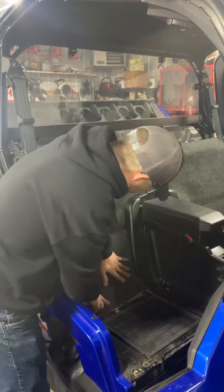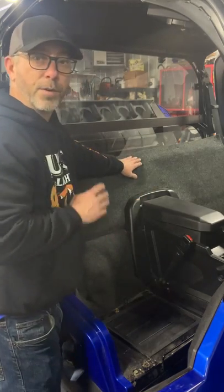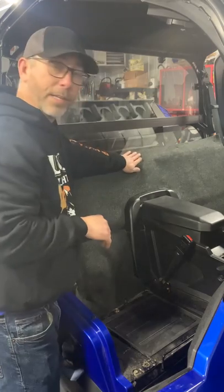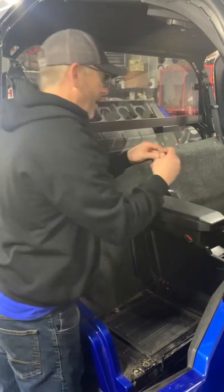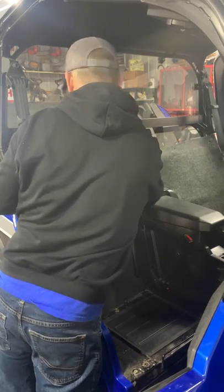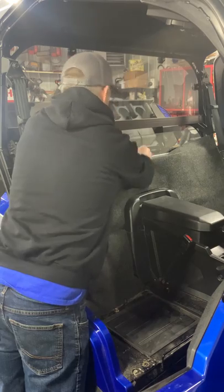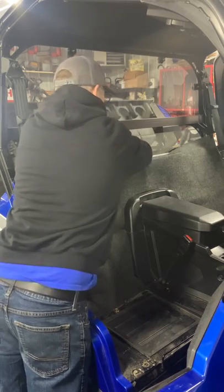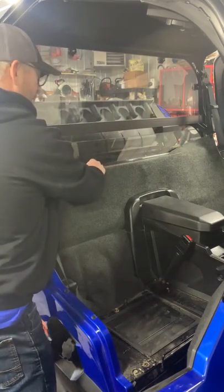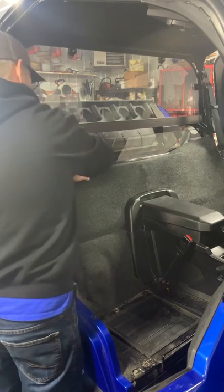You have to tuck it around the seat belt — it goes in that groove. If you do have to drill your own holes, use a 5/16 drill bit. There are five hole locations. You want to start in the center with the middle one, get it fitted nice and tight, then mark and drill your first hole, pull it tight, mark and drill your second hole, and so on — you work from the middle out.